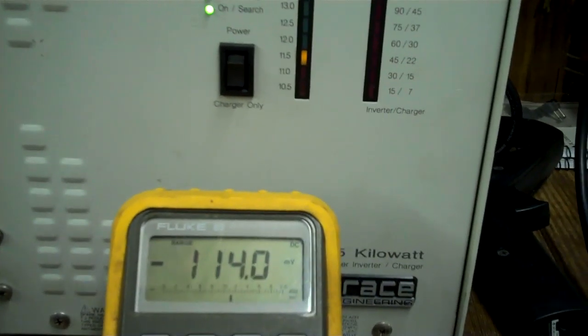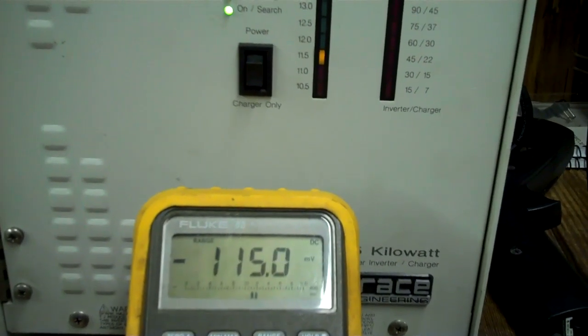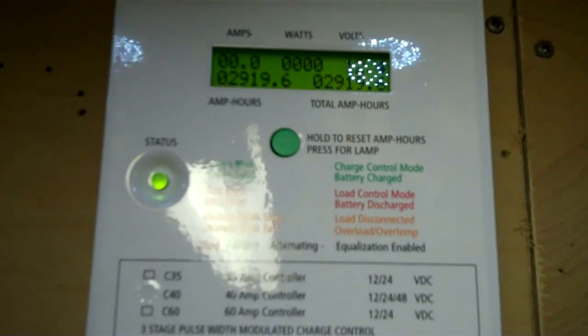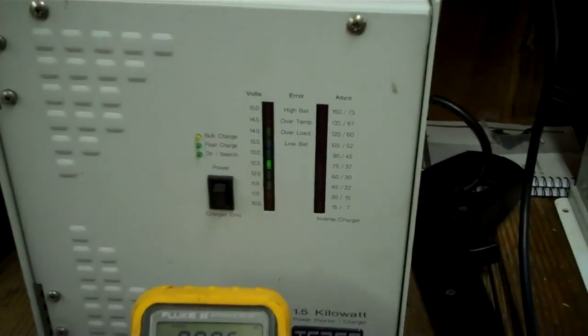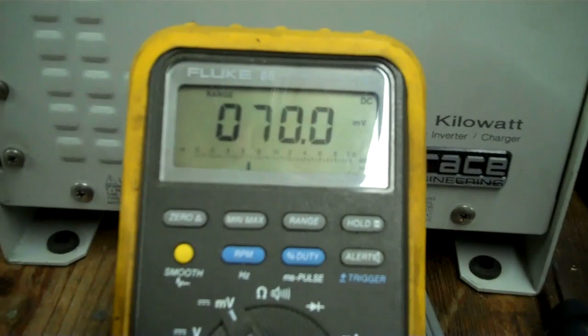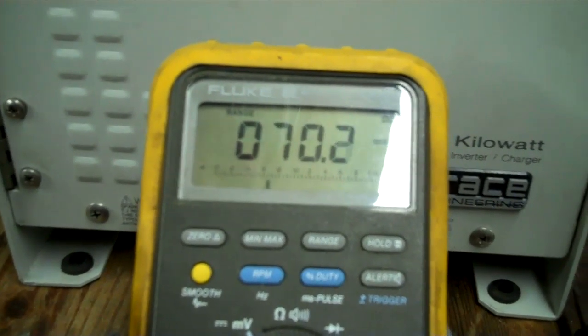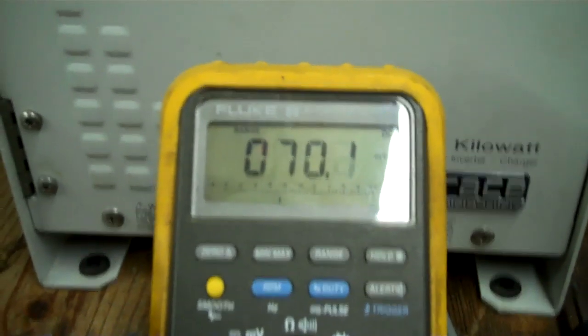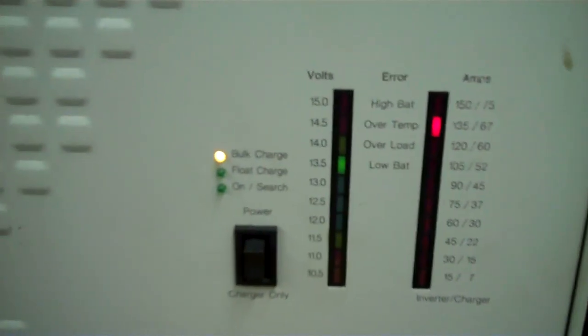I ran this thing for about five minutes on a pretty big battery bank. I'm going to turn the heater off and you're going to see the voltages rebound pretty quick. If it gets anywhere near 12.6 volts, it tells me the bank is still relatively full. So I'll plug it back in and it's going to wait a minute and then charge the battery bank back up. Now it's charging at 70 amps, which is fairly substantial. Of course it's going to take a lot longer to charge it than it did to discharge it. Rule of thumb: you've got to put in 30% more than you took out. Inverter chargers are cool.